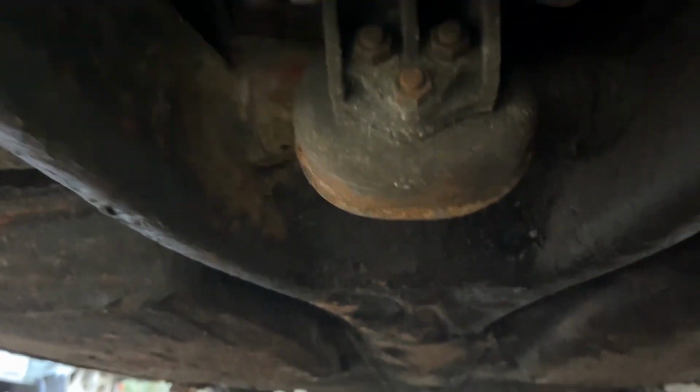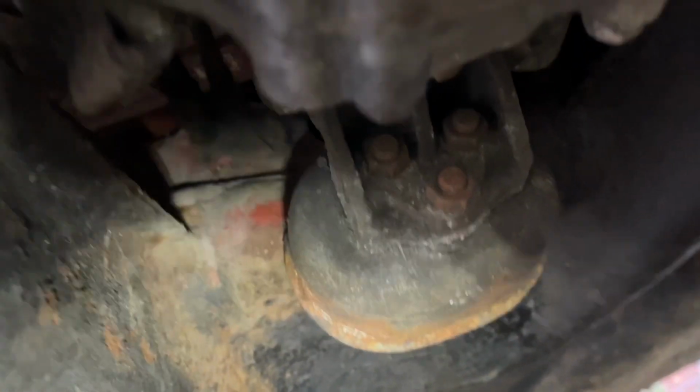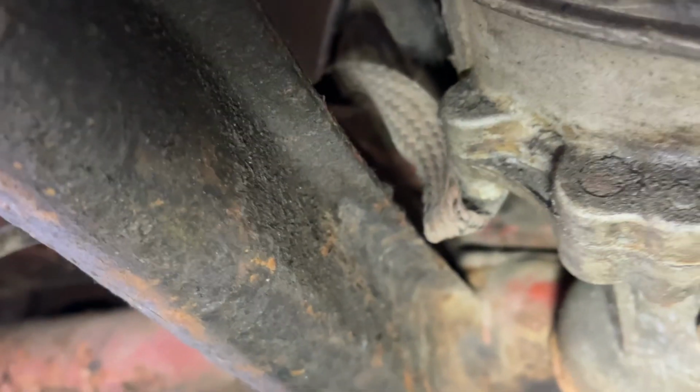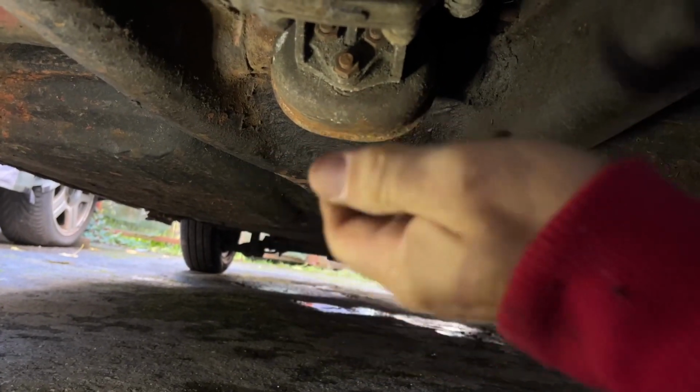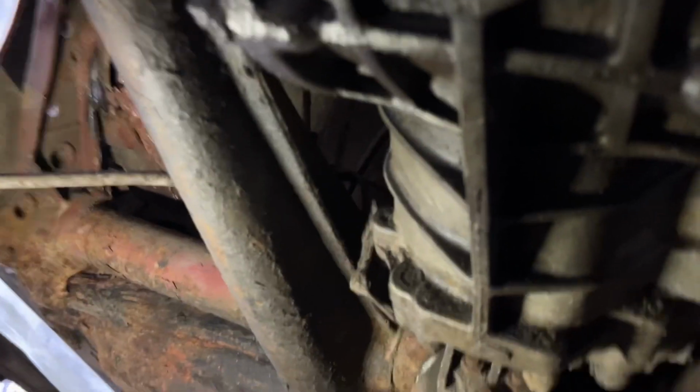So let's get back to the Beetle and sort out that gearbox earth strap. Back under the Beetle. Gearbox earth to chassis. There. I'll clean up both ends and we'll try it again. Bit tight under here. See you in a bit. So the actual earth cable doesn't look too bad, but there was white corrosion from the alloy gearbox, so I'll clean up them ends. Just cleaned up the bolt, nice and clean. Undo the other end and we'll go from there.